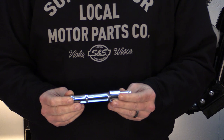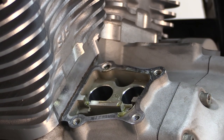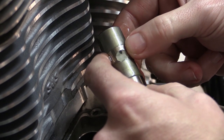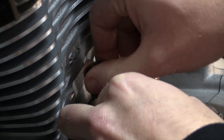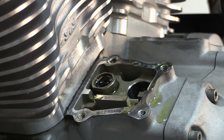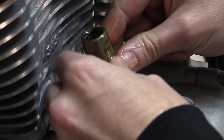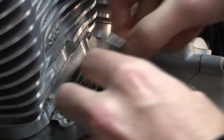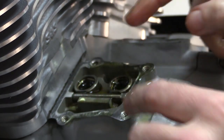Now we're ready to put the tappets in the motor. When installing the tappets within the engine, we're going to go ahead and remove the anti-rotation pin out of the way. On the actual tappet, you will notice there are two flat sides and a hole in the back. You want to make sure the hole faces the engine. Slide it in, making sure you keep your flat sides parallel so you can put your anti-rotation pin back in. We'll put the anti-rotation pin back in, making sure everything is aligned. We'll repeat the process for the front.